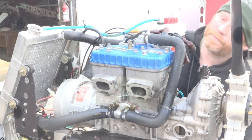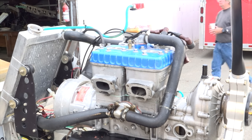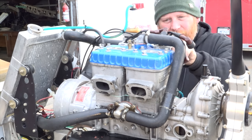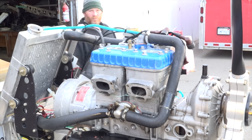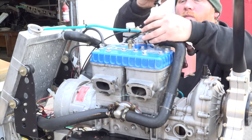You can see that nice even cross-hatch in there — it looks like the cross-hatch was really strong. That helps a little bit. So while we pull the head and all of the accessories off this thing so we can get into the cylinders and pistons, we want to summarize where we are right now. We pretty much have a good idea of why the engine stopped — that would be the seizure of primarily the magneto side. We'll look at the PTO side in a little more depth as well.